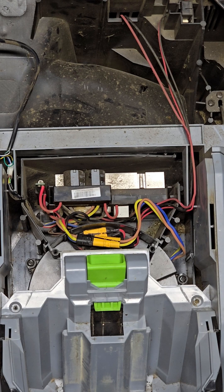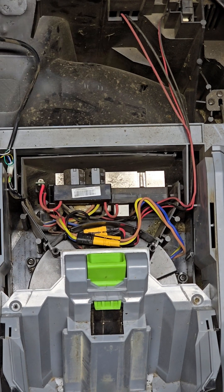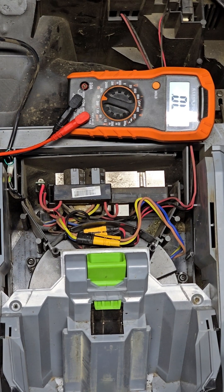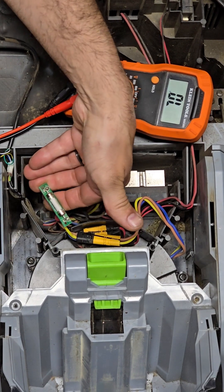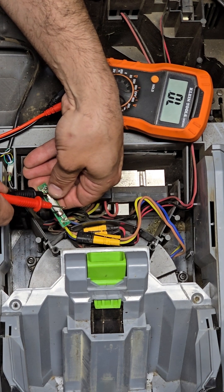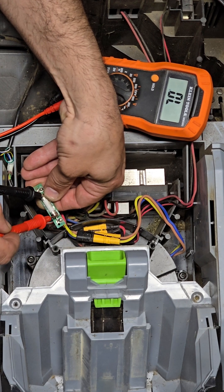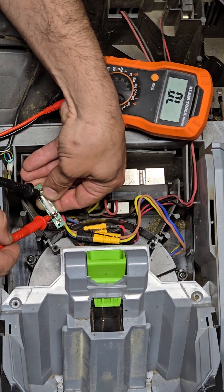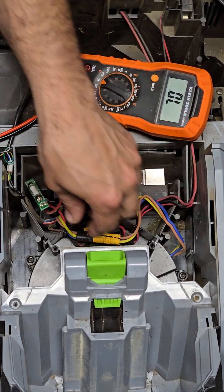While we're here, let's take a look at the issue with this unit — no power at all. Here is the main electrical assembly. I'm going to get my multimeter ready. First thing we're going to check is the fuse, which is this component here. It is soldered on. Now if this is blown, there's usually a good reason — I used to try to change just the fuses and they would blow again. We're getting an open reading, so yes, the fuse is blown. This is no good, so let's try to figure out why.